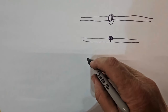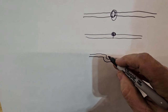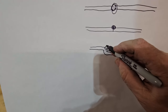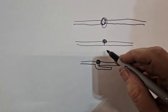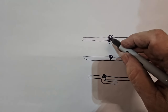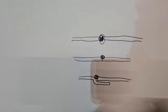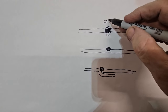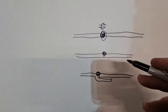Okay, lap weld, what I mean by lap weld is some guys take a flanging tool and flange it and then put the piece on like this and then weld here. Again, same problem as this one. You don't have full penetration, so you want to have a little bit of a gap so that whenever you weld that bead, it's in that whole piece. And you're going to know when you hear it. So a butt weld with a small gap so that the penetration can get through to both sides, it's always going to be 100 times stronger than that.